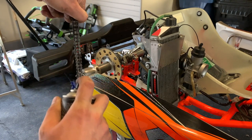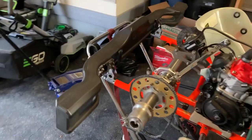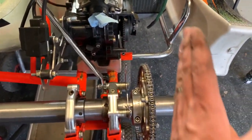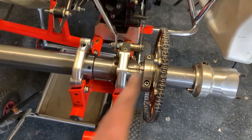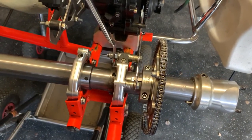I'm just going to lube it up first. The reason it's all kinked like that is because of the O-rings, but the chain is still good. You can see I've got the chain on, and I just noticed that the sprocket is way over here and the motor is way over there — that's kind of funny. So we have to get this moved over, which means I've got to redo this chain guard.